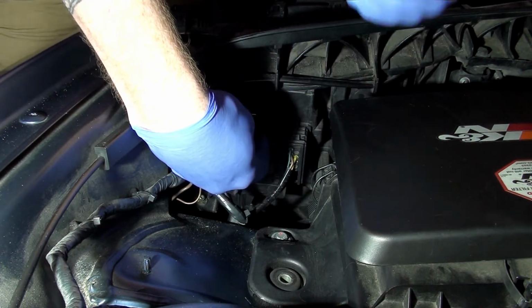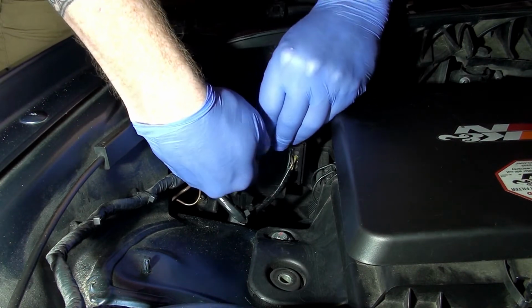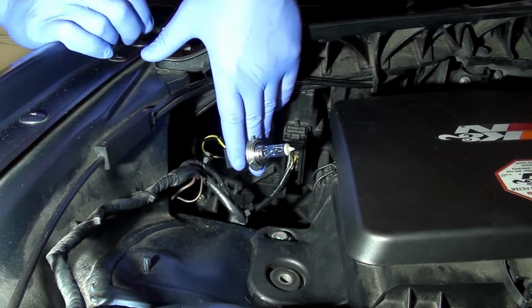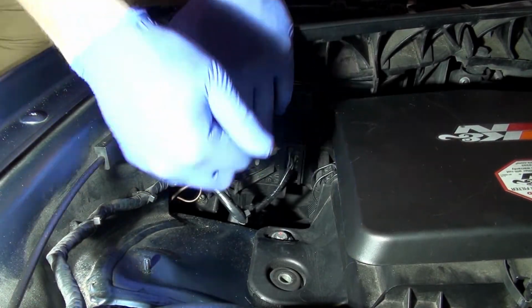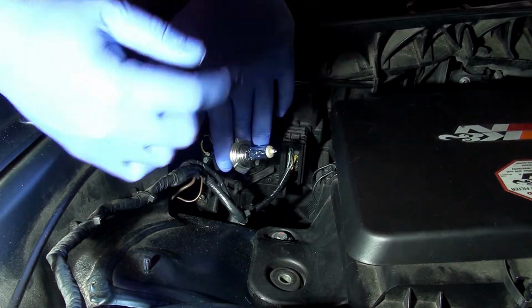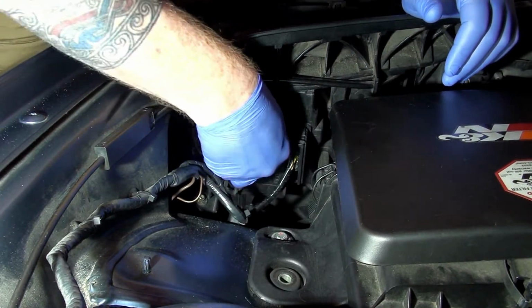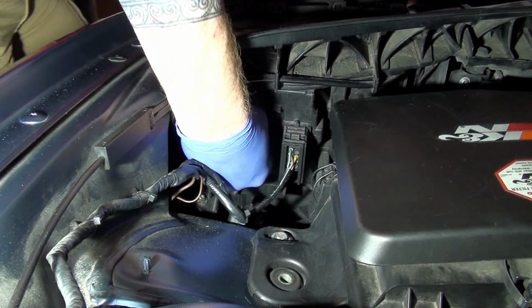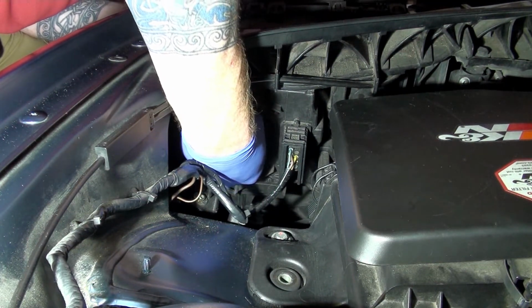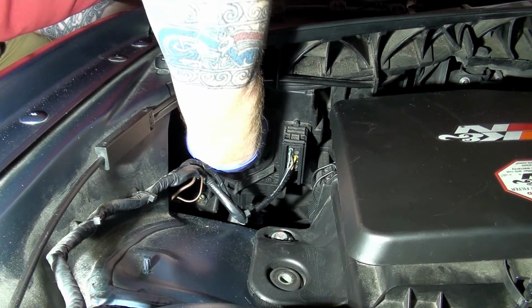So I'm going to plug it with the notch up, because when you put this into place, it's going to go notch up in the headlight, because the collar on the inside of the headlight is round across the bottom and has a notch cut out at the top. So you're going to put the new bulb in, feed it back in here. And the other thing you can do is, if you look from the front of the headlight, you can carefully guide the bulb in so you don't scrape it up or bang it up. And that notch goes right on that top orientation.